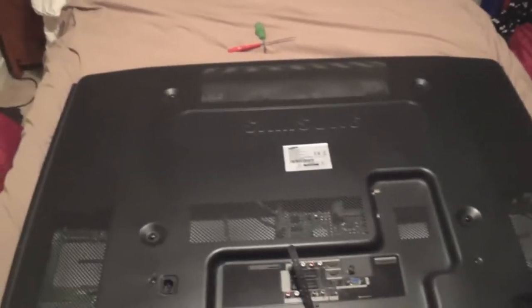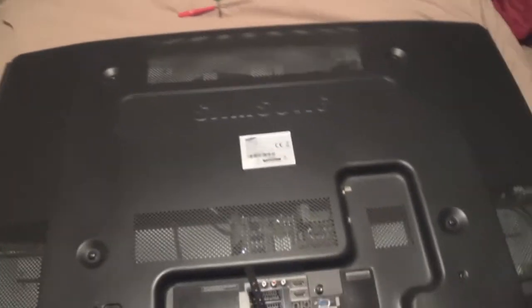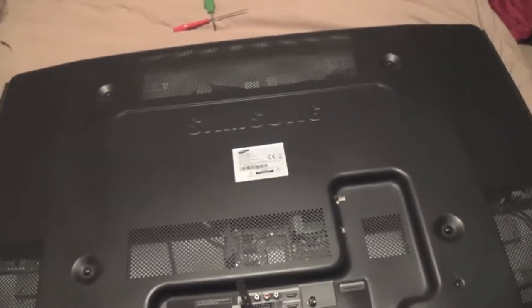That's what the owner said to me basically, and that problem is, in my guess, broken solder joints on the power supply, which is very common on I think all Samsung plasmas apart from the real older ones. Ones like this and above, even the newer ones had a lot of issues with broken solder joints - I've fixed quite a few.